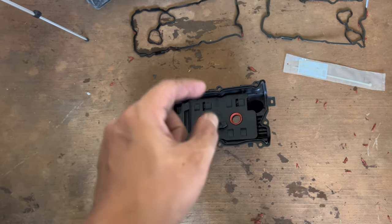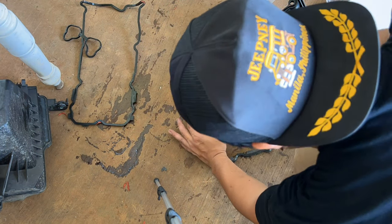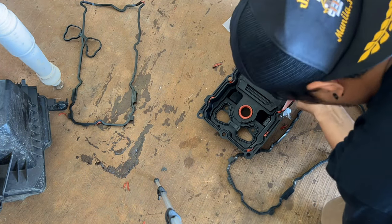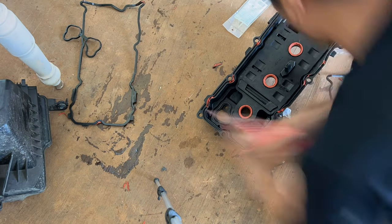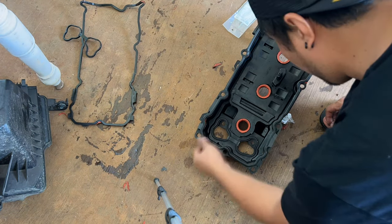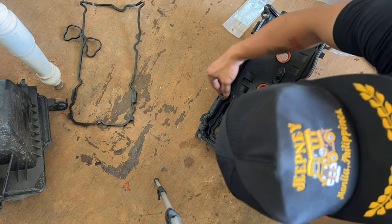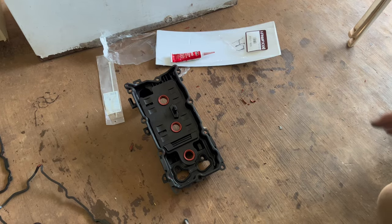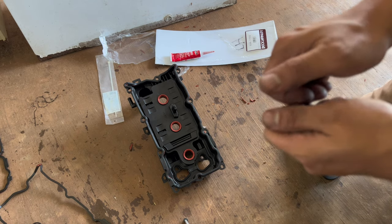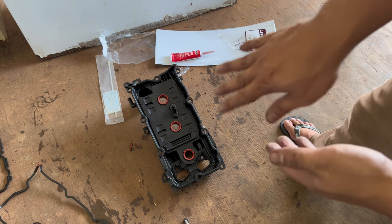We finally put back the intake manifold. We connected the intake hoses as well as the other hoses that connect the intakes together. We put the connectors in, put that evap line back where it's supposed to be, as well as this line right here. We put everything back to where it was. Now we got these two bolts, and there's that wire in the back coolant line — we put that back. We connected all of these lines and hoses — we just got to secure them. There's another line here that goes to the coolant — we connected that. Don't forget that. These two bolts go over there where they're supposed to go, then the six long screws go in. We're putting back this intake connector, and then the fancy cover, and we're going to start it up.